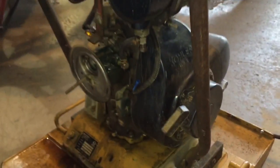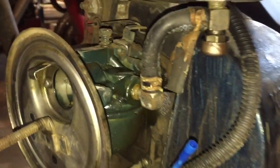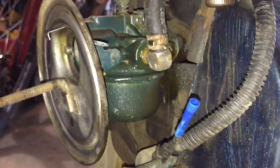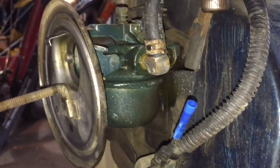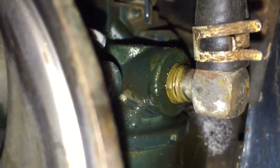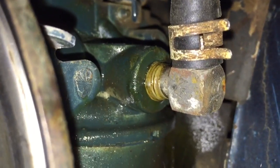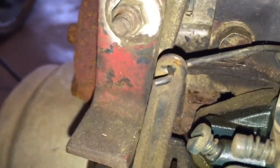This is an old whacker with a Kohler engine on it, made in the USA. I got an issue - this is an old points engine too. I was just putting fuel in it and I got a stuck float, because all my fuel is dripping out. It almost looks like it was coming out of the fuel fill there, but you can see there's some Teflon tape on those threads, so I don't think it's leaking there. I'm thinking it's just a float bowl.